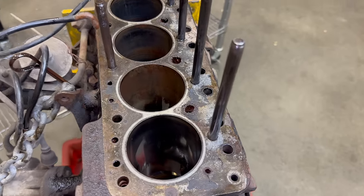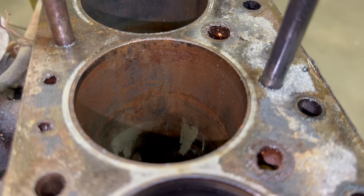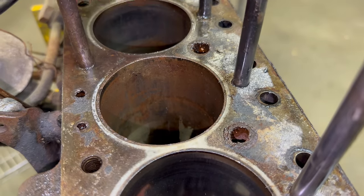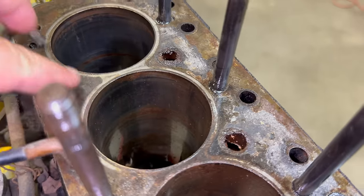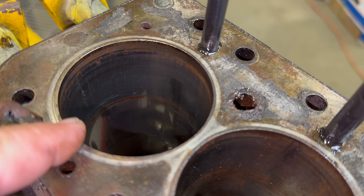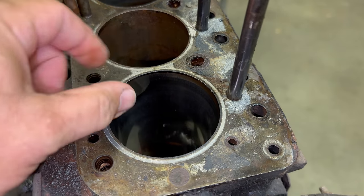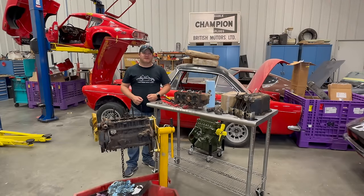Taking a look at the cylinders now, they don't look too bad. Cylinder one looks okay, cylinder two is the rusty one — this is definitely more than just surface rust, but I think it will probably come out without going over 40 thousandths oversize. Cylinder three actually doesn't look that bad, and cylinder four is about the same as cylinder one. I don't even feel a ridge at the top of the cylinder. So it appears the only failure this engine had was being improperly stored for decades. And that's going to be it for today — if you want to see more updates on the barn find Sprites or this engine, comment below and click subscribe.